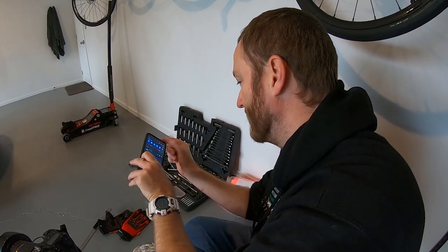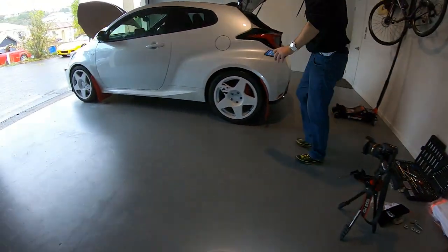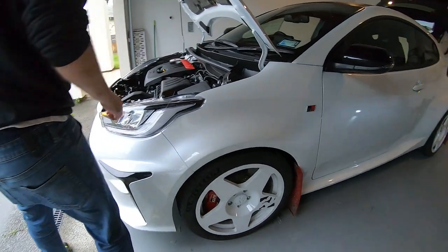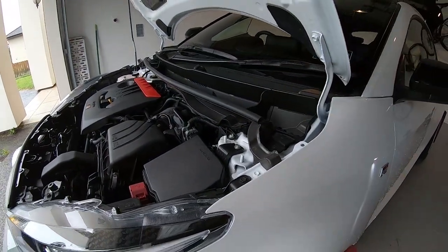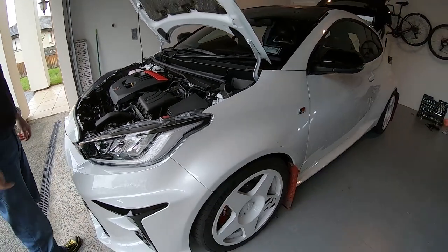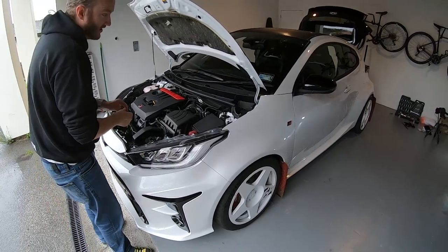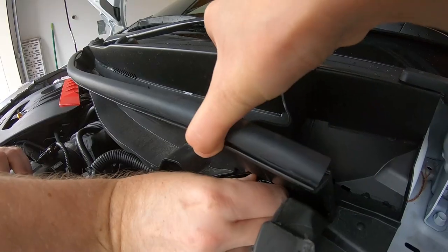Like if you hit a big pothole in your car, you need to get an alignment done because it knocks everything that's on a slider out of alignment. With this, it's not physically possible because it's captive at that specific camber amount. So they provide you with those and you can adjust it by half a degree of camber in various settings. You can have 2 degrees, 1.5 degrees, 1 degree.